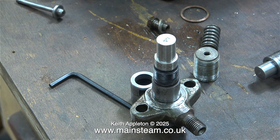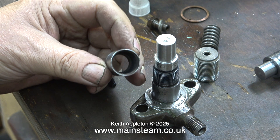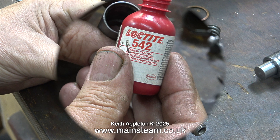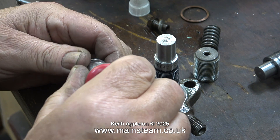I've just mentioned how difficult it was to remove the part that secures the nozzle to the injector. On the first injector that I rebuilt, using a serviceable but old nozzle, I left it connected to the pump overnight. The next day, still connected to the pump, there was a wet ring around the nozzle retainer. When I had refitted this retainer, I really torqued up the spanner — it was securely fitted — but there was still some diesel leaking from around the edge. I wondered if, when they were first assembled, some sort of hydraulic sealant had been used. I am no expert on diesel engine injectors, but I thought I would use some Loctite 542, which I use on a lot of steam engine parts that get very hot, and it seems to seal threads very well. That would also explain why this particular part of the injector was very difficult to remove.